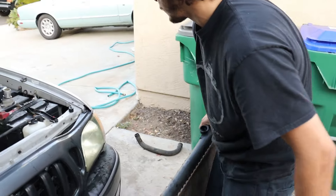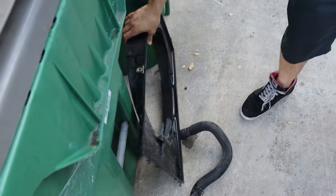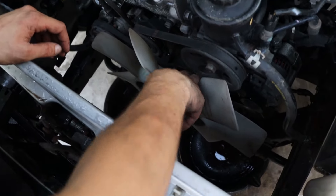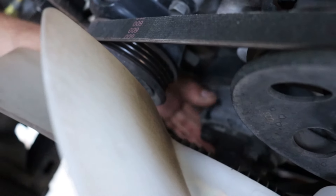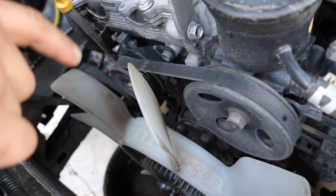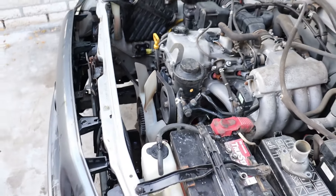Now to continue to the water pump. We're going to get this fan off — some 12mm bolts right there. You got to hold this hub. It's best to break them loose when the belt's still tight on it; it helps you hold that. So we'll do that, then take the belts off, get the water pump off, and bam — reversal. I've gotten 3 out of 4, there's always a pesky 4th.